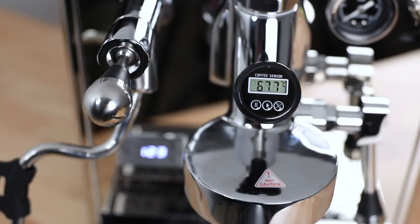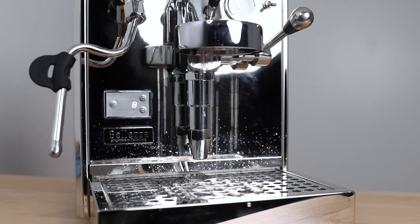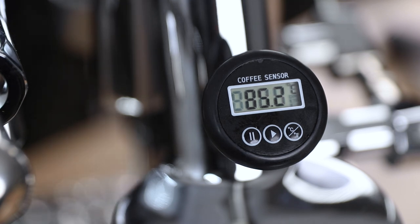But once everything seems safe enough and there are no leaks, allow your machine to heat up. Turn the thermometer on and then just take a moment to observe how fast your machine warms up. One key point to make here is to not test the temperature of the brew water without a portafilter and coffee in there running the shot, as the amount of water coming out of the boiler and the group head minus the portafilter and the coffee is greatly increased from the 40 mils or so out when you're running a shot. So it's not the best identifier for brew temperature, but could be used to see the thermal recovery speed of your machine.